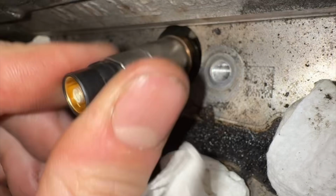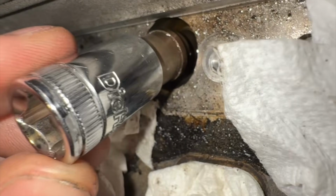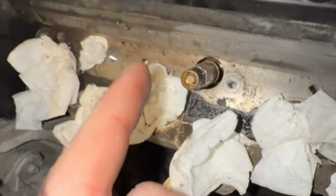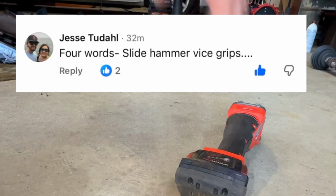That one has been pulled out and maybe a little bit tightened up, but essentially the body is catching on the thread. You could see how exposed this cylinder was, and I was able to just pull it right out. Well, 3 and 4 are just as exposed. So basically the thread's completely out. They're so swelled that they're just now touching where the base of the thread would go, and they're not able to be pulled out.